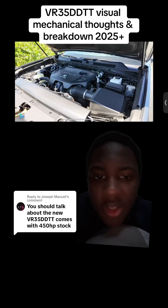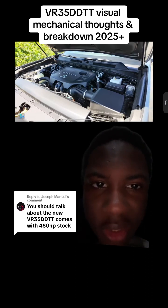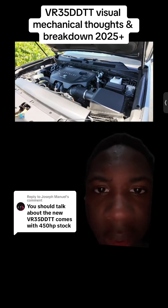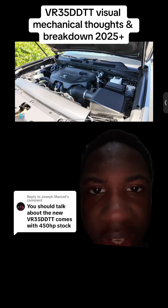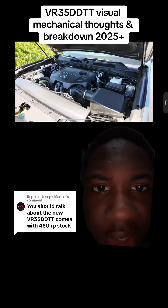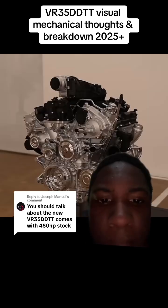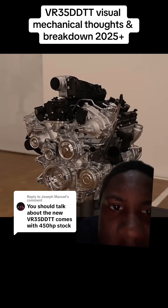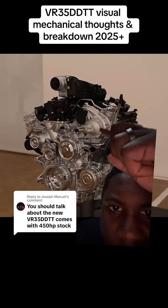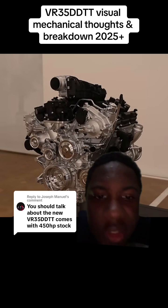I found this image off of a car reviewer. It's really hard to find any details because car reviewers show very vague information on the engine bay — that's how you know it's a horrific engine bay to work on. In the engineering aspects, what connects to the front throttle body has to be some sort of intercooler or interchiller, because the turbo cannot go straight to the throttle body or it will blow hot air into it. The intercooler is most likely at the very front of the engine, so the turbo will go up and around, through some sort of intercooler system, and then connect to the throttle body. That's my speculation until the car comes out.